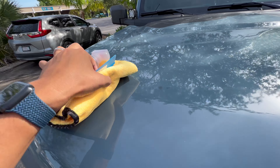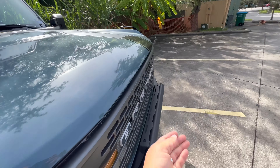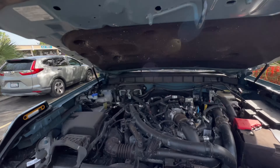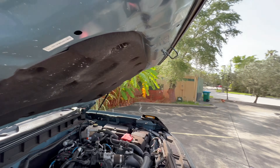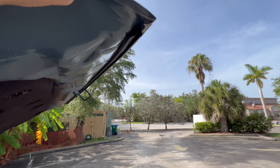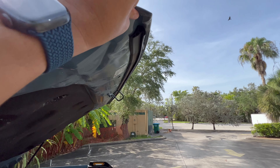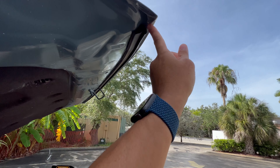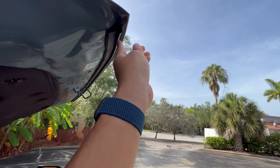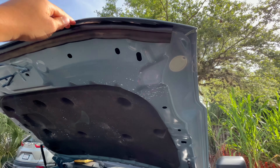Let me show you under the hood how far this extends. Have your hood latch already popped — we have it out to here. I haven't pushed back down on these corners. You can also cut, depending on how far you go up into here — you can cut a relief right on this edge, so these layers fold over each other. I didn't cut that relief because we were just test fitting this. You're going to tuck it in under all of that rubber.